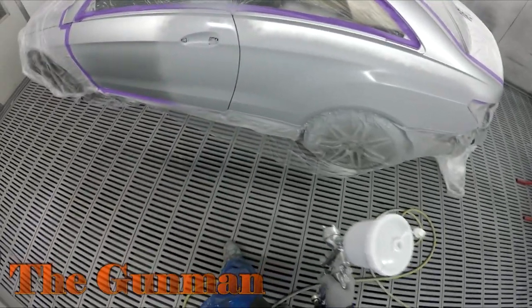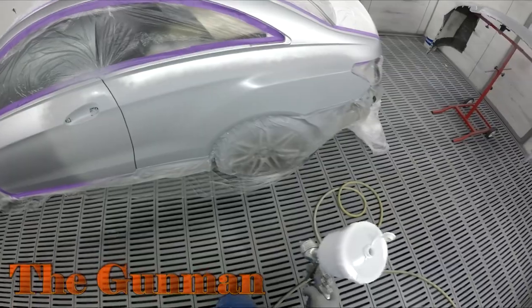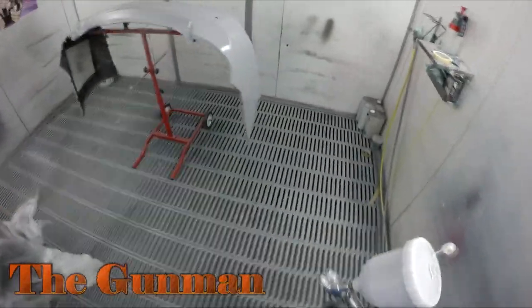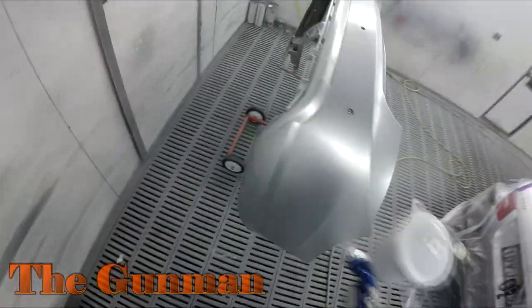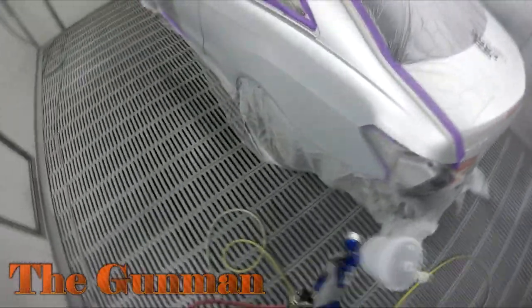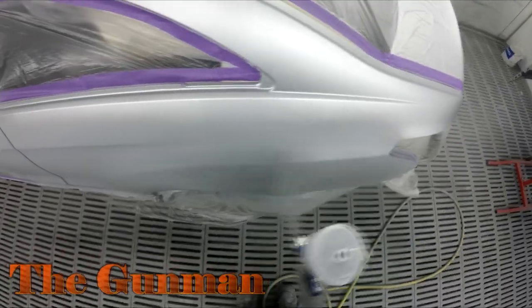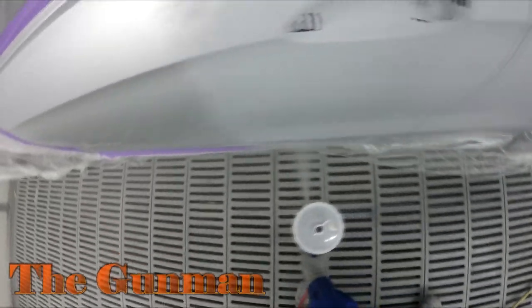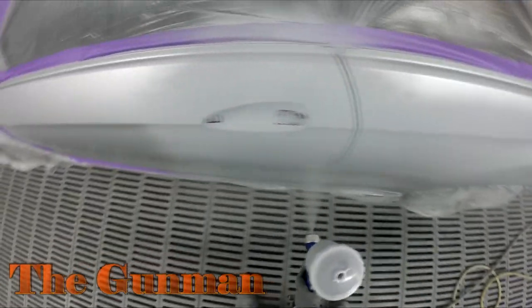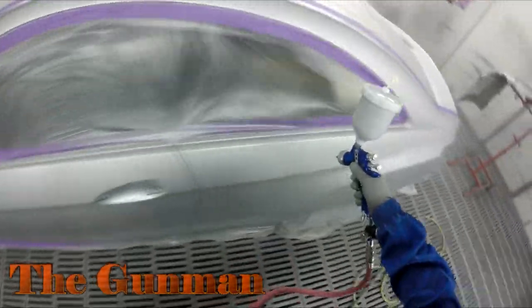Something I wouldn't usually do is blow air over my wet-on-wet primers, but this is definitely extreme circumstances. It's very uncommon to get this kind of situation and over the years it might only happen a few times. But I knew it was going to be a problem before I started painting, so I took measures to help eliminate the shrink back. As you can see here it actually ended up drying down a lot better than expected. Putting my first coat of base coat down, I just went light — you still need coverage, but don't go too heavy — and blow air on it straight away to get those solvents out.